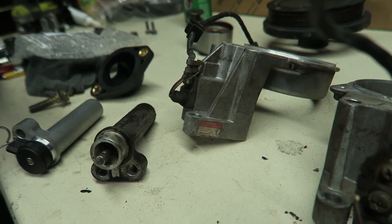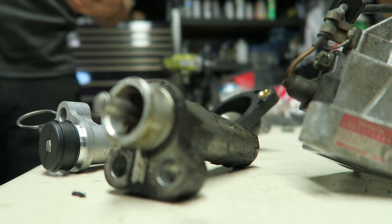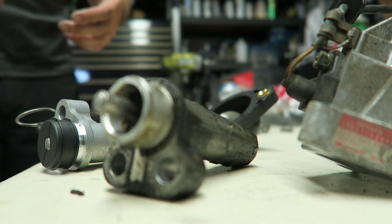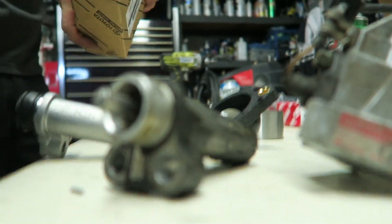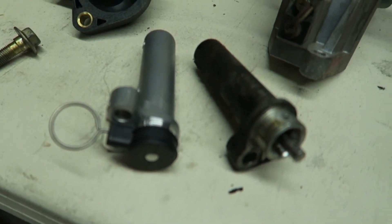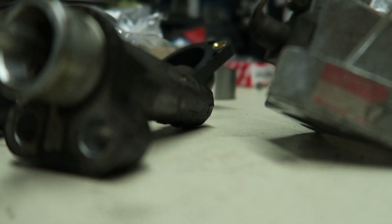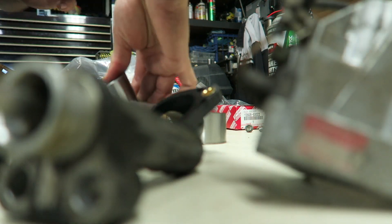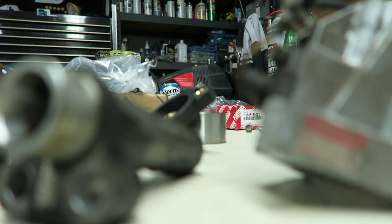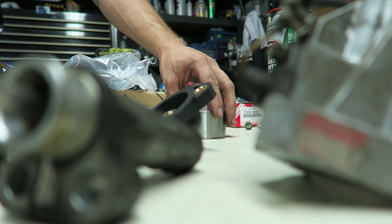You can feel the bearing — kind of feel it like the new one. You grab the center and just spin it and you're supposed to feel nothing basically. So if we look at a new one it's gonna be tighter, but you still feel nothing. Usually this one is the most tired — you can feel a little gritty feeling. So if you feel that in it, that means the bearing is kind of tired and about to go.